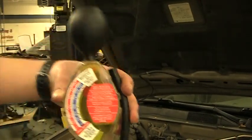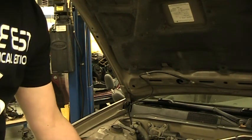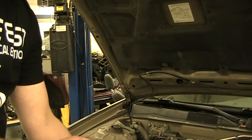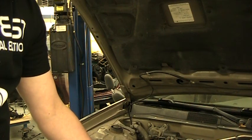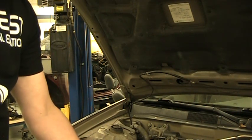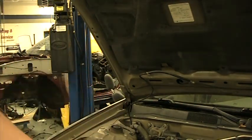A lot of people think the lower the freeze protection the better, but the problem is the coolant starts to get a little too thick and doesn't flow around the engine as well. So in this case we'd probably want to add a little more water to dilute it. That takes care of the freeze and boil point on the lab sheet.